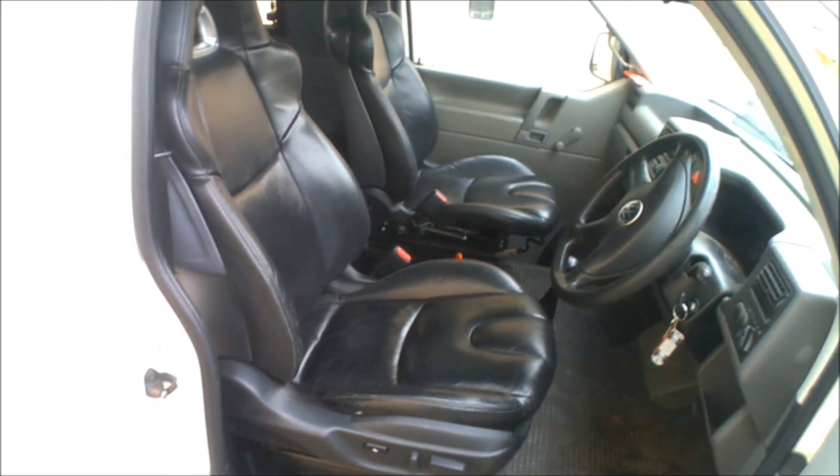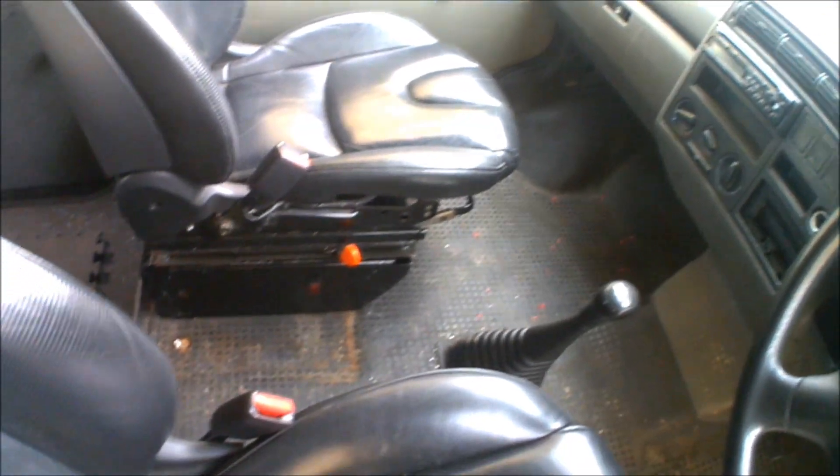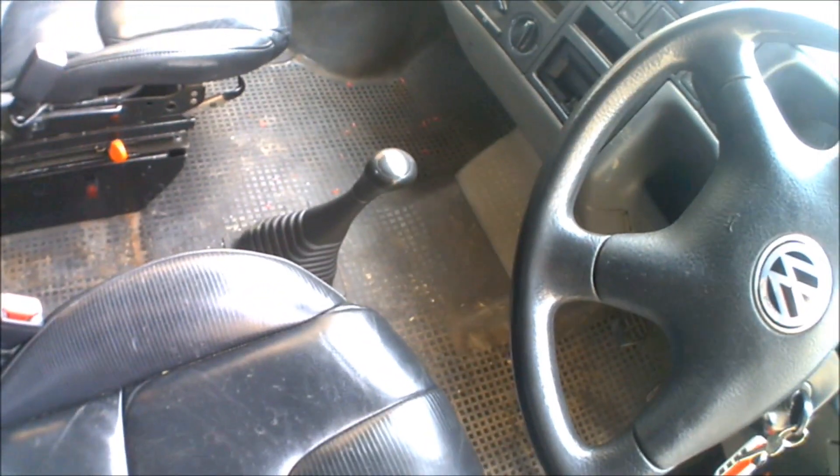Right, so that is the seat install fully finished now. I've even wired the heated seats in on both of the seats with illuminated switches. For the wiring for the electric driver's seat, I already had a 12-volt cable running down the side but when I tested it whilst running the fridge and also moving the seat, it was too much load for the inline fuse. So I decided to run a brand new fully dedicated line coming from the battery straight down into a 30-amp switched relay connected to the glovebox light — exactly the same switched relay I've used for the fridge as well.